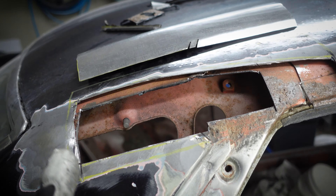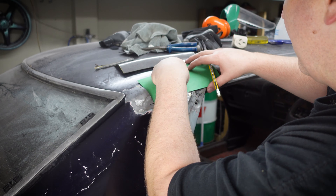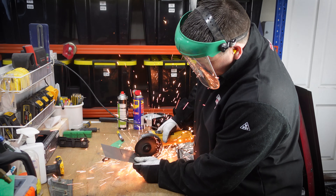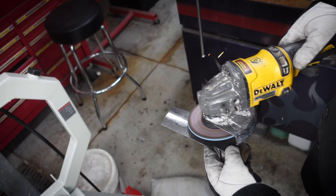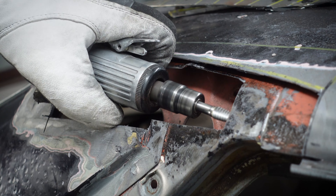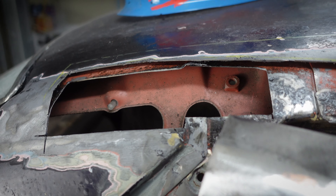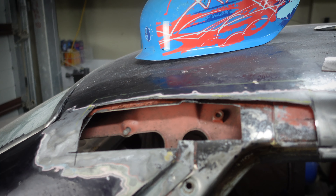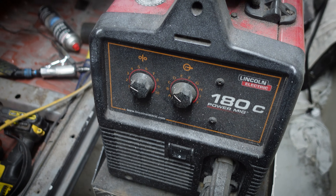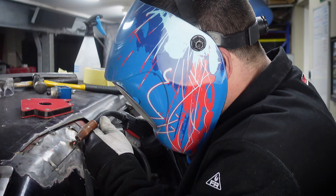You can see this stainless steel trim is folded at the top so you don't have a sharp edge, and then it comes down around the bottom of this channel and up the other side. There are two ways people go about this — you put your fingers in and pull down, which runs a quite high risk of denting it, or you put a screwdriver in from the back and pop it off the back lip, which is my preferred option. Just put a large screwdriver behind it and you're looking to pop the back lip off, which will let you pull it up. So there it is — screwdriver on the back of the lip, and there we go.